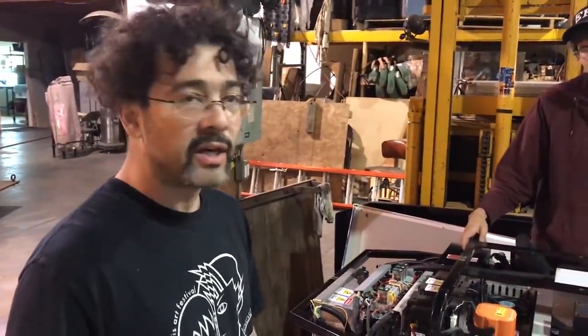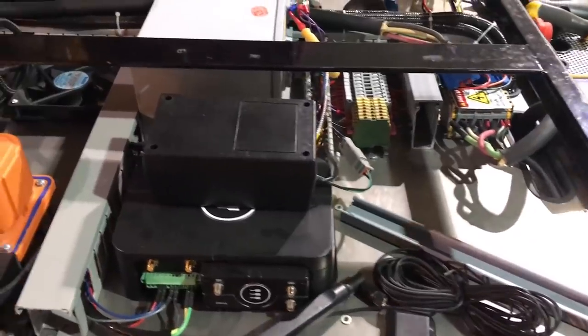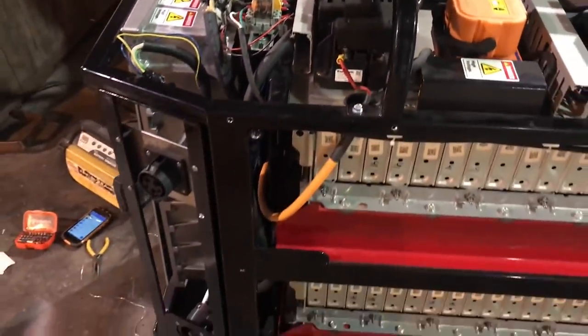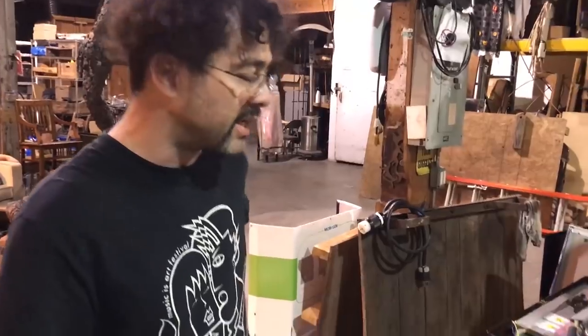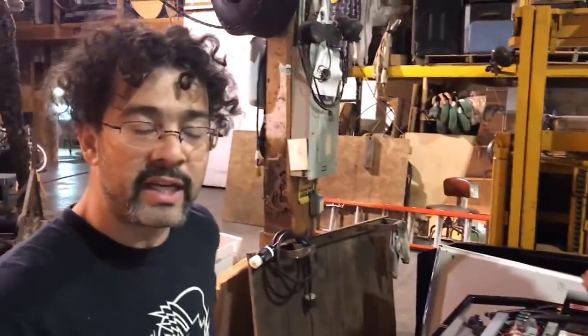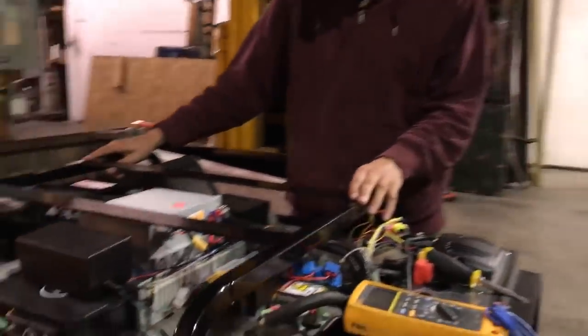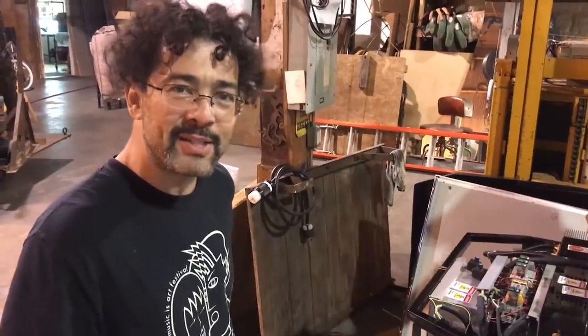But that's that movie — I don't want to spoil it for you. This van was made for the power companies, because the law also said power companies have to have electric vehicles. They used a government contract to make about 500 of these Chevy vans — they used to belong to Phil actually. The batteries in it are almost 30 years old — they're flooded NiCADs, the same kind used as primary batteries in an airplane. I'm going to put these batteries and some others from the same source in the van and make it cool again. Would you consider yourself a battery hoarder? Yeah, that's exactly what I'd call myself.